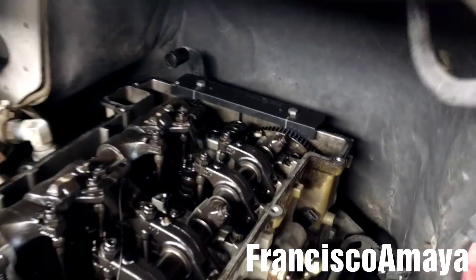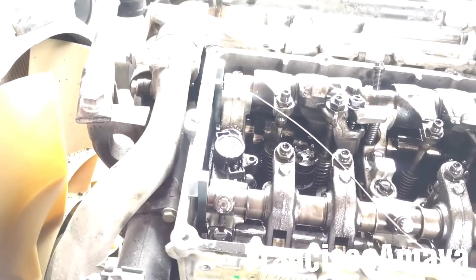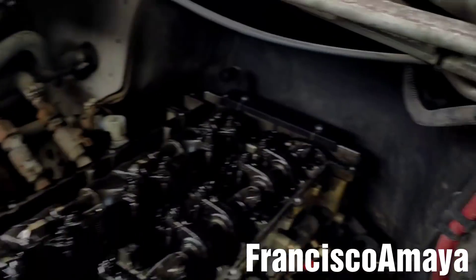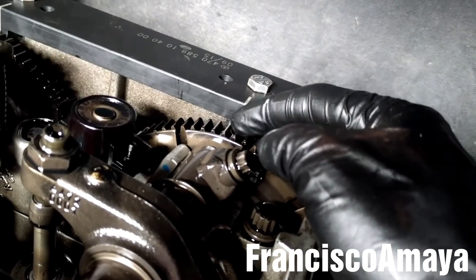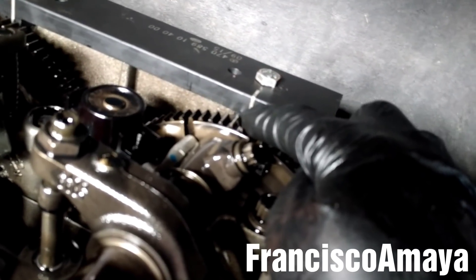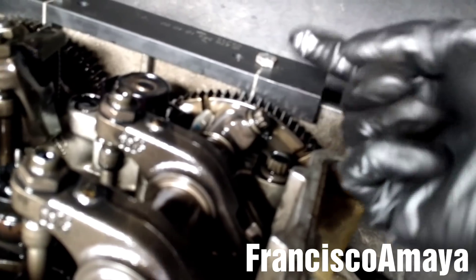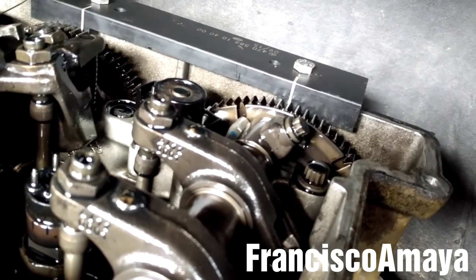The timing is set. You can see it's in the position it's supposed to be. I'm going to install this bolt to secure the front tool. In the cam gear over here in the rear area, it has a little mark that you have to align with this. If for any reason you don't know the position of the valves, just look for that mark in the rear area of the cam gear — it's like a triangle that points up. Align it with this mark over here and the timing is set.